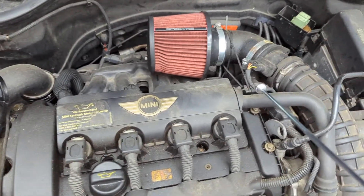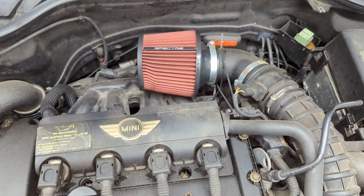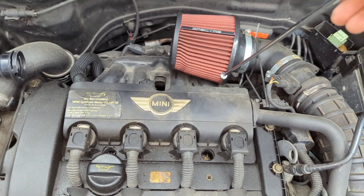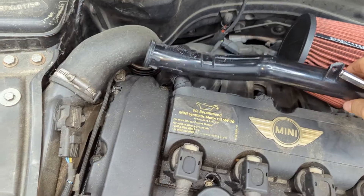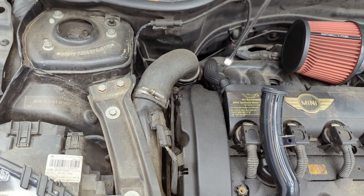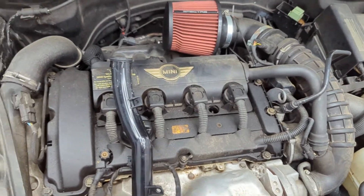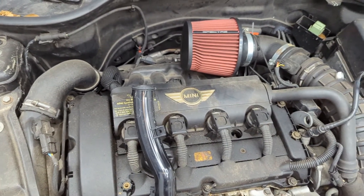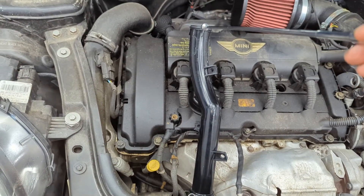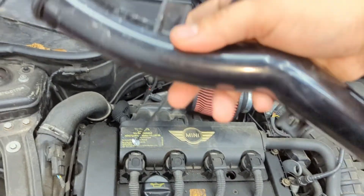The next component that's very prone to fail is the crossover tube, and this connects to this little guy right there. When I replaced mine, it was such a common failure I bought an extra one just to have it. It runs underneath your intake manifold — that does have to come off to replace it, but don't let it scare you, it's not too bad. Once this starts to break, you get a fun little puddle of coolant on your passenger side right underneath your block. That was the very first thing that broke on mine within the first two weeks. This coolant system is so unique. When it works, it works great. The problem is the components they use aren't great — this should be an aluminum or steel piece from the factory in my opinion, but they give you this really cheap plastic that's good for about four years.